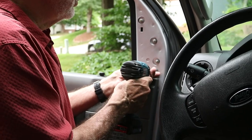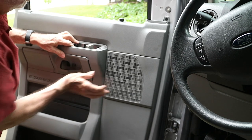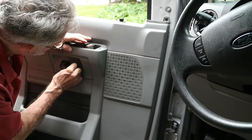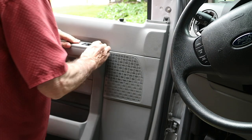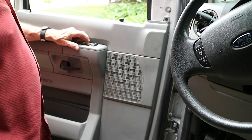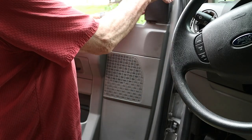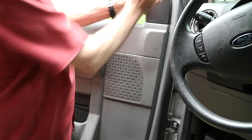Let me check - make sure that mirror works. Yeah, it does! Okay, let's screw this thing back on. Put these four screws in. This goes on from the back, screw it on, then that clip. There are two little slots where that fits in. Those two wire harnesses clip in, pop down. Mirror works, windows work, locks work. One more cover at the bottom - this clips on here; that tab goes behind the door panel. That's a wrap.